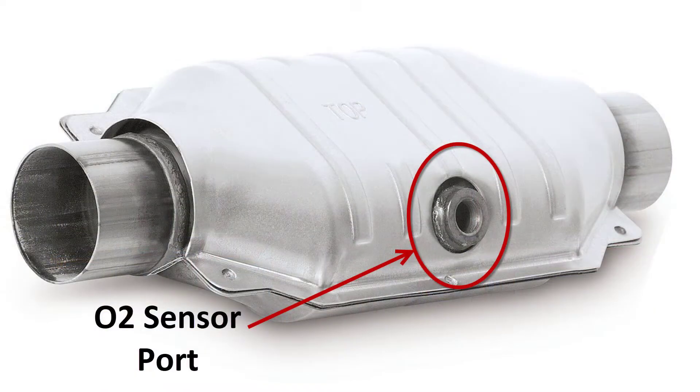A good flowing exhaust system you'd probably have half a pound even at 2,500 RPM. But that can be misleading, because if you're trying to hook into where the O2 sensor ports are, the clog may be before or after that point, so it's not going to help you actually pin it down.